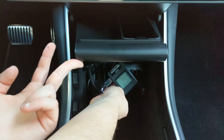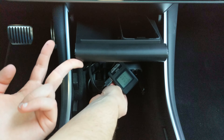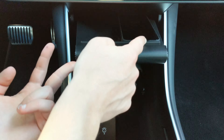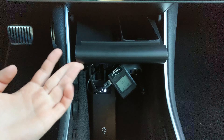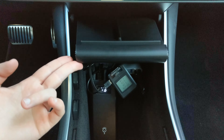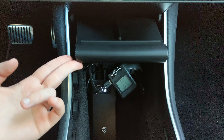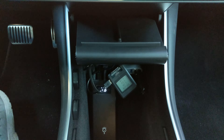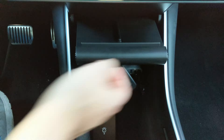Right now I have a power meter connected and we're showing 0.9 amps coming from the battery pack up to the right side of the dock, which is about what it should be for this phone. If I take the phone off we drop down to 0.02 amps — very low, which is good. You don't want anything silly going on that's going to cause this pad to heat up.